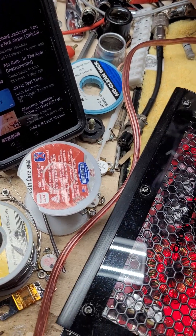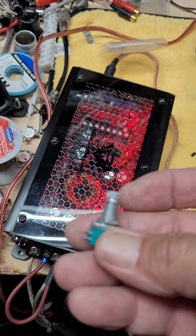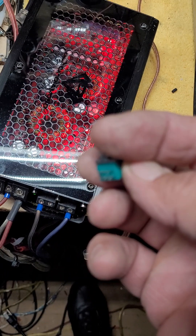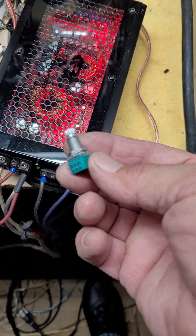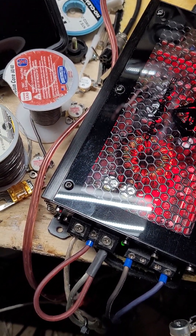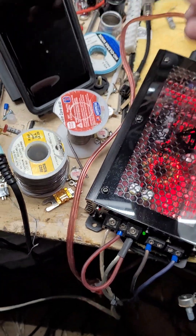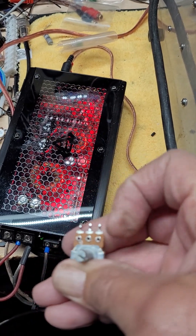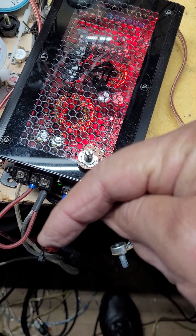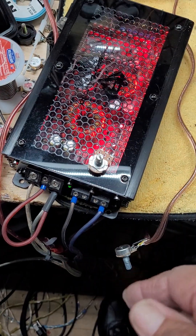The Stinger remote knob is a little gizmo on a circuit board in a flat right-angle metal plate, so you can mount it in the plate or panel mount it through a surface in your vehicle. The remote is very common if you've noticed this with bass remotes — they seem to only give you control from about 7 o'clock to 10 or 11 o'clock on the potentiometer. You turn it all the way down to 7 o'clock, you got nothing. Once you hit about 10-11 o'clock, it's full on, and from 12 around to 5, there's nothing — it does nothing.